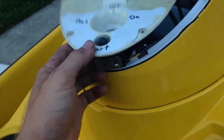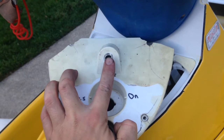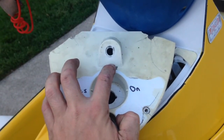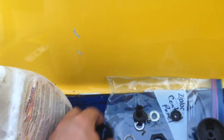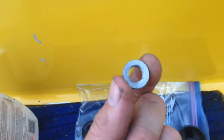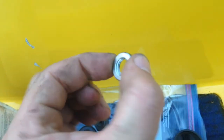That's really easy to install. Your choke lever is going to go up here — just put the cable through there, line up the flat part on the cable mount with the flat part on here, stick it through, and then it will be this screw, real thin, it's threaded, that will hold that on.